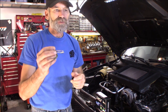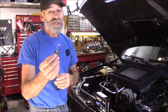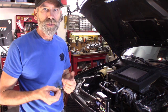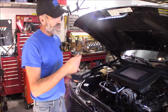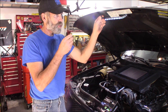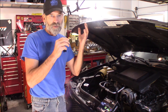I got these out of a self-leveling thing for an RV. There were four mercury switches in there — when you got all four lights lit, you were level. I salvaged these and I've literally had them for 25 years. I've used one so far, so in the next 75 years I might use the other three. I got that mercury switch mounted up in here — I literally just glued it with some RTV. I got it at the angle I wanted, and as I pulled the hood down to the point where I wanted it to shut on and off, I positioned the mercury switch and let the RTV set up.